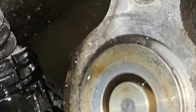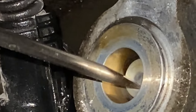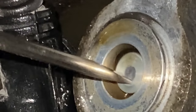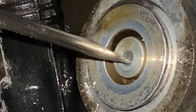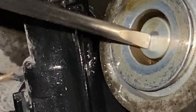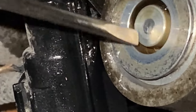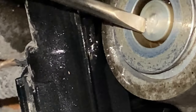And that's the solenoid plunger there. So imagine that goes up and down, up and down, up and down. And that's the bit that actually actuates the oil pressure. I'll probably put a screwdriver in. So that's the oil pressure activation valve, look. It's pulse width modulating, going thousands of times a second, many thousands of hertz. So if you can imagine, probably that's full oil pressure, and that's like no oil pressure. Could be the opposite way around, I'd have to study it.